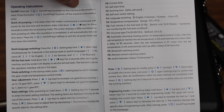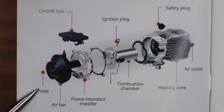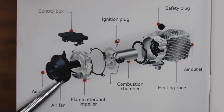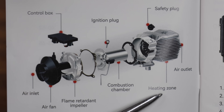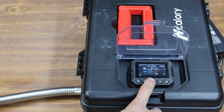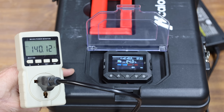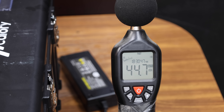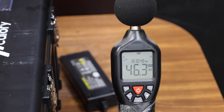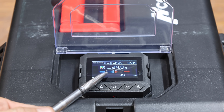The H-Calorie has the best set of instructions so far and seems pretty easy to follow. Air enters the inlet with the help of a fan, then passes a flame-retardant impeller, ignition plug, combustion chamber, safety plug, heating zone, and then the air outlet. During the warm-up cycle the H-Calorie reached a peak power demand of 140 watts, about the same as the VIVOR. There's a small amount of exhaust smoke but a lot less than the Civil. The fuel pump is at around 60 decibels, and the H-Calorie is fully warmed up in about five minutes.